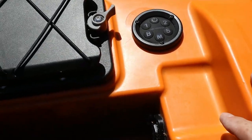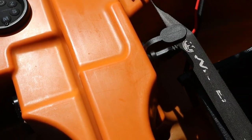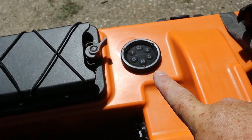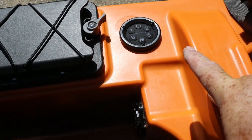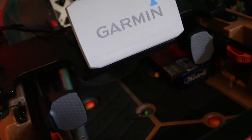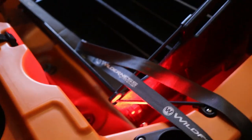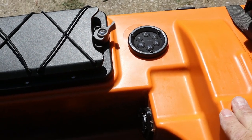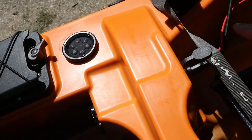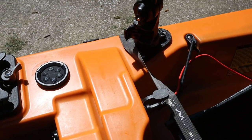I have a Yak Power power panel. Inside there's a box with five connectors, powered by a connection on the outside that runs back to my battery box. I have the primary power button. Switches one and two are for live scope: one is the fish finder itself, two is the black box that controls the panoptics transducer. The bow mount switch controls the front lights. The mid switch controls internal lights I have rigged up in case I get caught out after dark or before sun comes up. Red lighting is really good as the least attractant for bugs and makes it easy to see inside the kayak. S is for stern, and I still have one switch left which eventually I will use for the USB ports to power the back camera and recharge my cell phone.